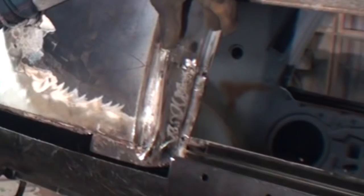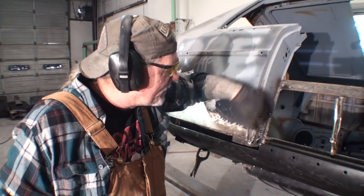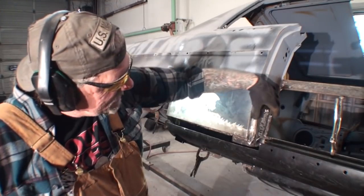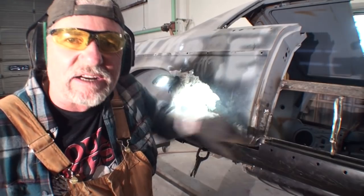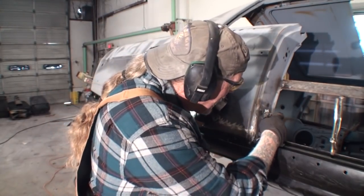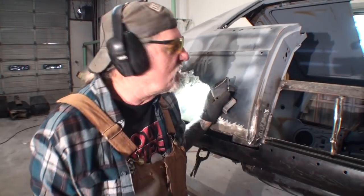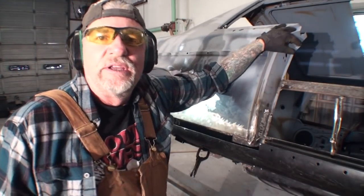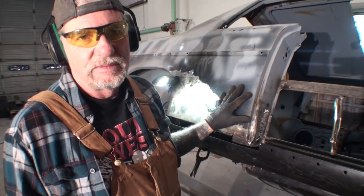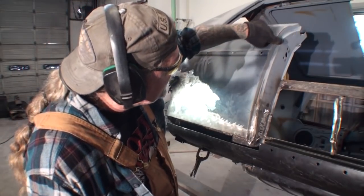So I had to take this piece out, and this was off the four-door car. We found out that the four-door — whatever post you want to call that, the D-post, the door opening — we found out that the structure was different. So what I had to do is I had to split it down the center right here, and widen it out. I tack welded both pieces on and then I had to add metal into it. Let me explain: on a four-door, this is part of the quarter panel — when you get a new quarter panel, this piece is molded to this piece. On a two-door, it's not. This is a separate piece, and it's spot welded, and then once it's spot welded it's got seam sealer that goes all the way down. Do you see the nightmare that we've got going here repairing this car?